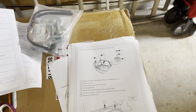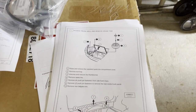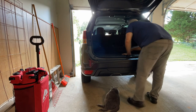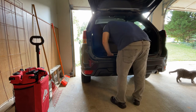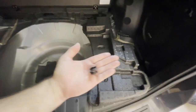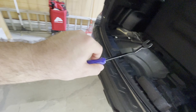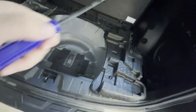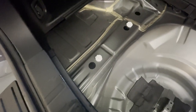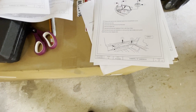The first step is removing the spare tire and everything in the back. I've got a couple cover pieces to remove to access the backside of the bumper. Just a heads up on the foam inserts in the back - there are little pins you have to remove. I used one of the tools from the clip kit. They do pop out and make a scary sound but none of them broke. The last step is removing the rear tailgate trim using the clip removers.